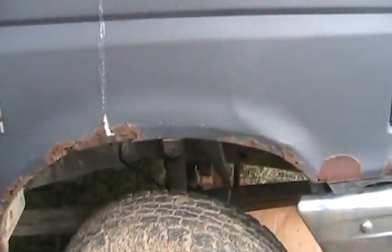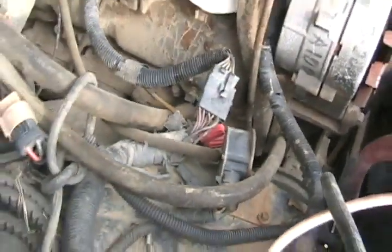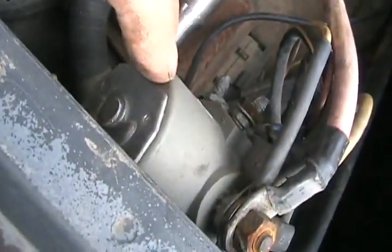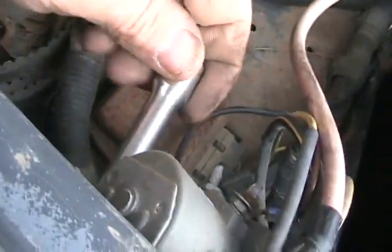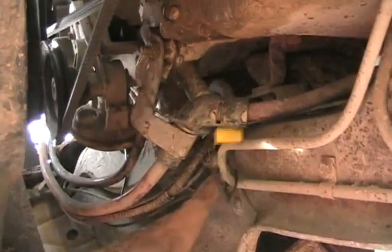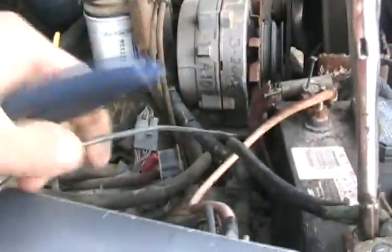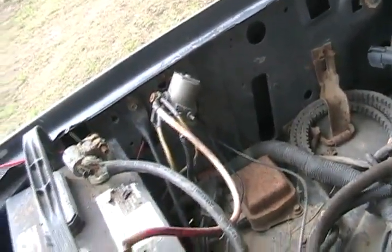The final solution: I've got a roll of wire. I'm going to crawl underneath and hook my piece of wire to that burned-off ground body wire. Since it's too hard to reconnect it back to the frame, I'm going to run it all the way up here to this solenoid. I just realized this is a dual solenoid vehicle — there's one on the starter motor and one here. Since the body isn't grounding, this one's doing the rapid clicking, causing the one on the starter to do the same. I'll run that ground wire and ground the solenoid up here. My new wire is securely attached to the ground point of that solenoid — let's see what's happening.